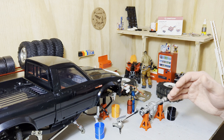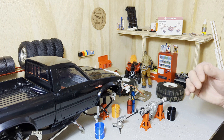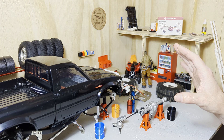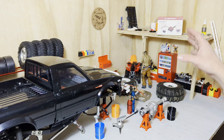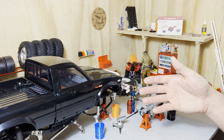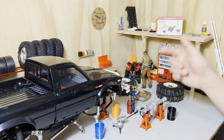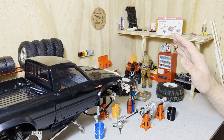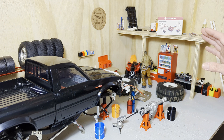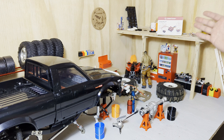From zero to a hundred percent drag brake, it's definitely better than just setting it and being stuck with whatever you chose. I didn't like it killing my battery while sitting on flat ground — I wanted to set it depending on the situation. I'm actually starting to like the real car mode and might not even use the drag brake. In real car mode, as soon as you push the brake all the way down, you're at a hundred percent brake — if you've set it up that way through the programming card. So I have to say, there's no downside to the new 1080 G2.